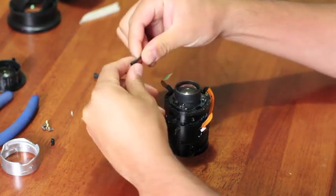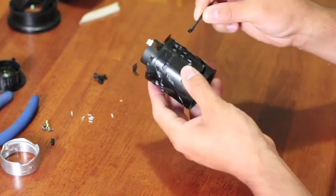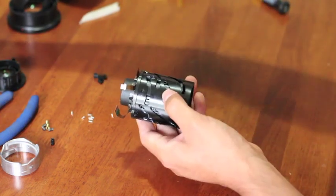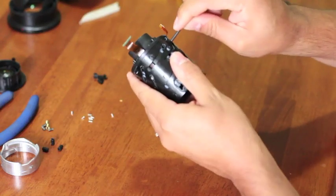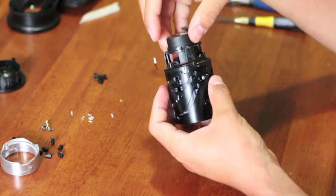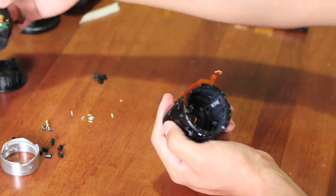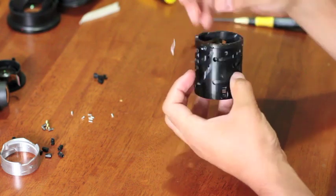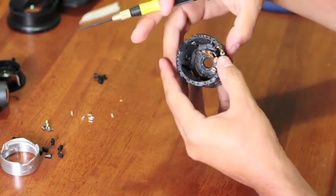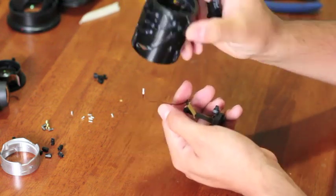The silver ring to the bottom left I've already removed by unscrewing the three screws holding it together. I've also removed all the screws shown and I'm only using a Torx to pull the plastic black ring that's holding the final inner barrel together. Now you can pull the inner piece out — all that's left is the barrel and the brass clip holding the flex cable. Once you unscrew this clip, the flex cable falls and releases the inner aperture.